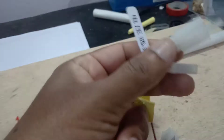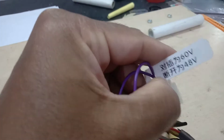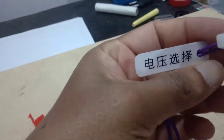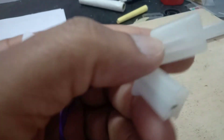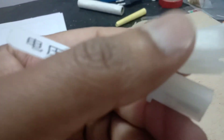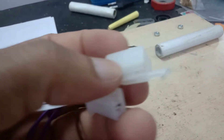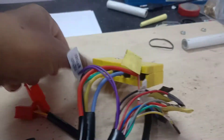There is a blue wire linked together with some Chinese writing on it. While it is disconnected, this controller runs at 48 volts, and when you connect these two wires together, the controller runs at 60 volts. That is the use of that wire.